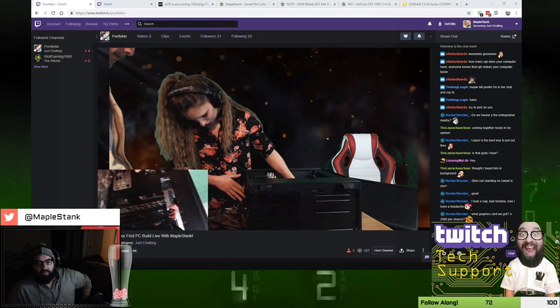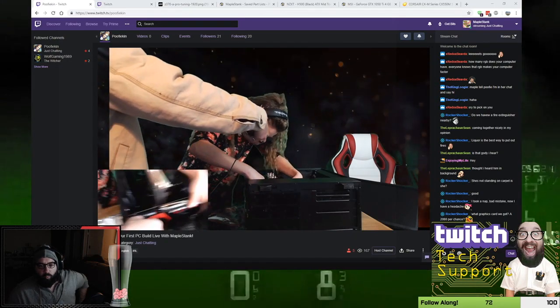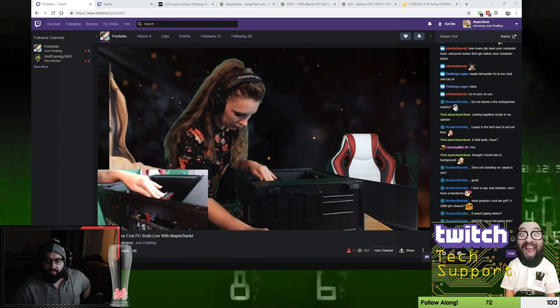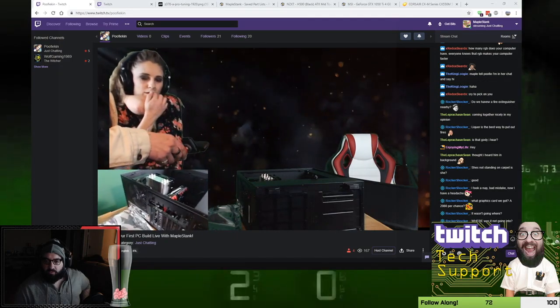The screws at the top, it'll look like they won't line up right away, but get the slot in first and then worry about the screws. So that slot, it'll slide right down. It'll almost clip in, basically. Now that you got the graphics card in place and it's dropped down, you're going to drop that guillotine bracket back down in the back and tighten up those screws.